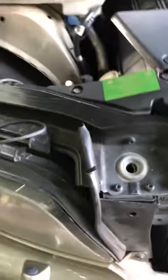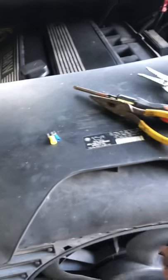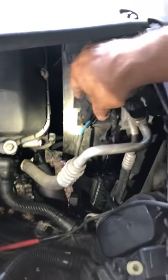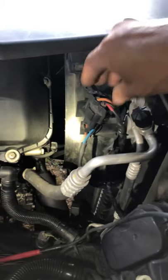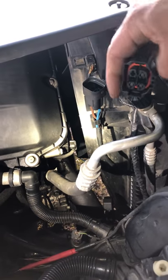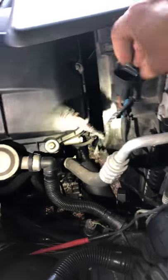I got a BMW 2007 X5 and the cooling fan is not working. Every time we turn on the AC, the car gets pretty hot. So I'm gonna test the fan directly — I'm gonna hardwire it directly just to see if the fan is working, or if it's a relay, a fuse, or something else. This fan has a plug right here that I've disconnected. This side comes from the controls and the relay, and this side goes directly into the fan. So I'm gonna apply direct current to it.